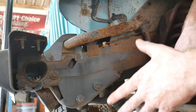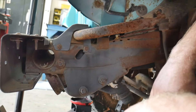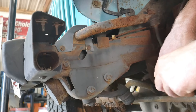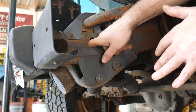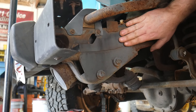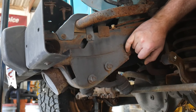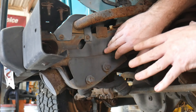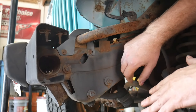So the last section of the frame we'll talk about is this front section - really the first 12 inches of the frame is where we'll sometimes see rust build up. A lot of that is because this is the section where the frame starts to come down and things can pull up here in the bottom. Amazingly, looking at the center section versus this section, it looks night and day - this is not a different frame, it's the same frame we've been looking at the whole video, but this area is about as good as it's going to get. There's no delamination on the inside. One thing you'll definitely want to look at is especially the driver's side, because that's where the steering box mounts. We've seen some frames where you'll develop a crack if this area rusts from the steering box mount up into the frame, so definitely if you start to see rust in this area make sure you get it replaced. Somewhat the same on the passenger side front, though not as critical since there's no steering box there, but we have seen rust build up at the front passenger side as well.